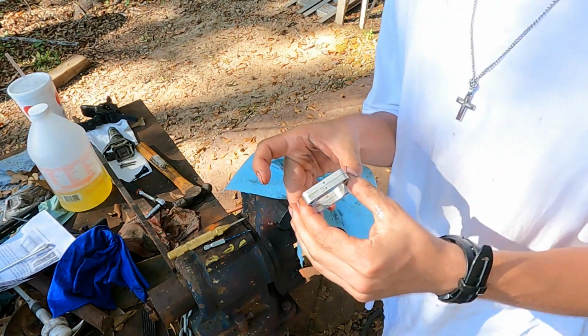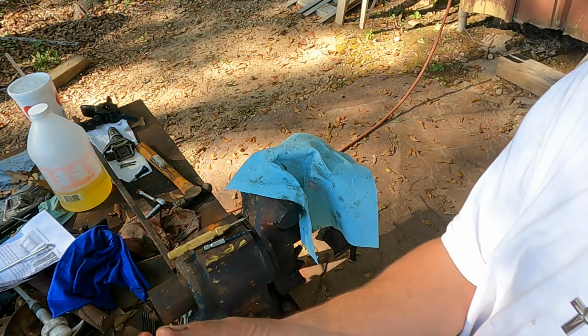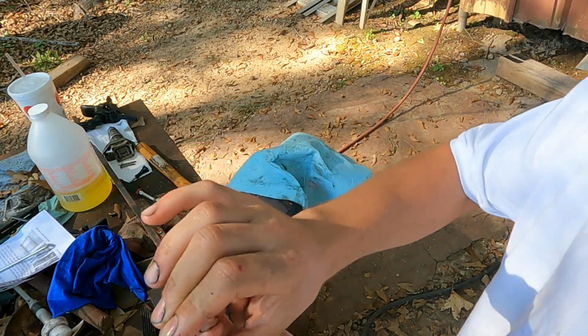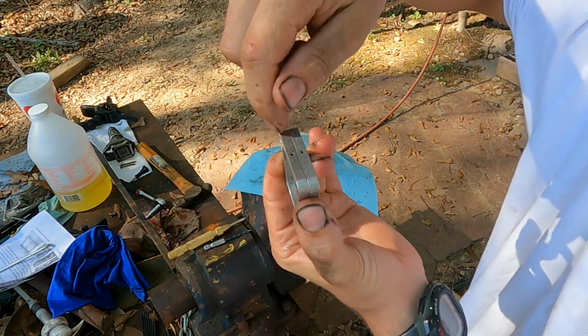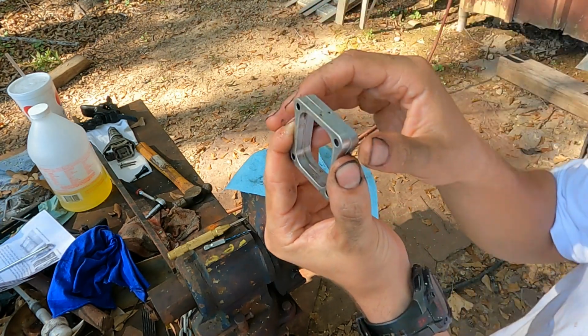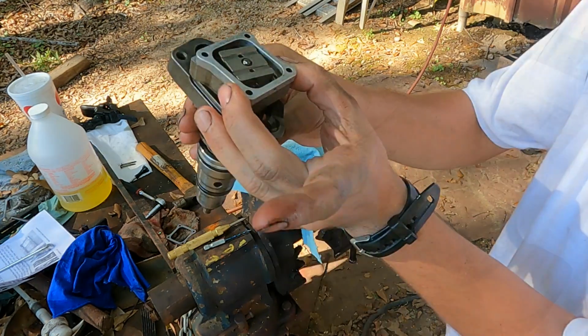Alright, next step in the process. So we're going to clamp these in the vise, sandwich them to where they're exactly aligned. We're going to center punch a hole right in the gap and drill a 3/16 hole, splitting the circle between the two. So when you unclamshell these two, you'll have a semicircle right here.